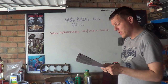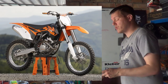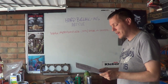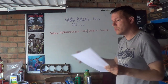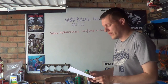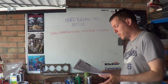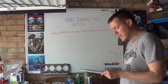This is from the KTM manual for the 250, 400, 450, and 525 SX, XC, and EXC — off-road four-stroke dirt bikes. It says: do not load the engine more than 50% of its capacity during the first three hours of operation. This is different because these are race bikes meant for competition — you don't have thousands of miles to break them in. Engine speed must not exceed 7,000 RPM for the first three hours. Avoid full throttle. In the following 12 hours, load the engine up to 75% of its capability and use the motorcycle on various types of terrain.